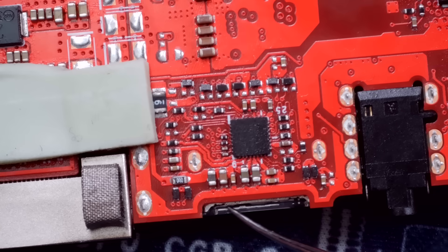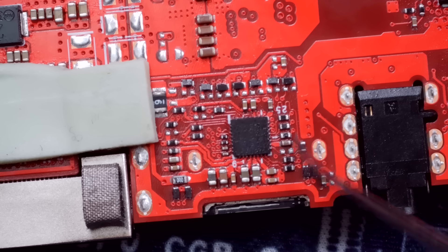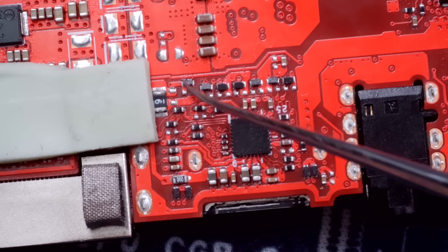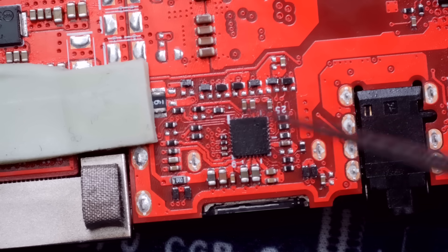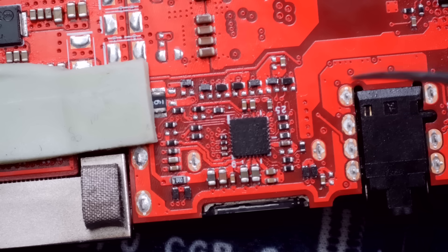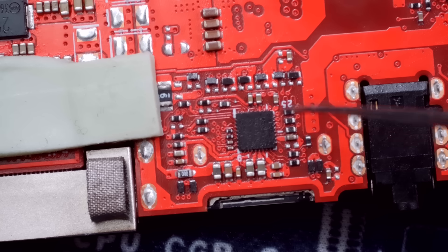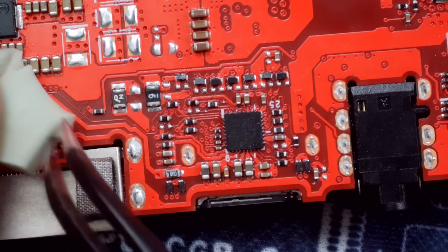This is the SD card slot right here, and this is the back side of it. This is why they were saying it's liquid damaged. While I can say there are little bits of what looks like probably flux residue, there's absolutely no corrosion or anything like that on this board. For them to say it's liquid damaged — I'm just not sure I'm on board with that. The person did heat it up to reflow these components, which got the SD card working at least for a while. Technically he did mess with the inside of it, but I can't say I would call this liquid damaged. There has been some liquid on the board — meaning flux — which is kind of meant to be on boards for soldering. Normally you clean flux off, but it usually doesn't cause damage.